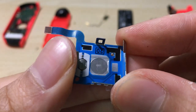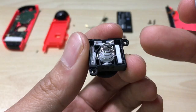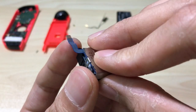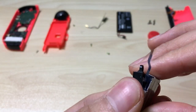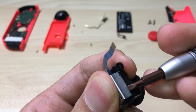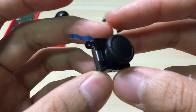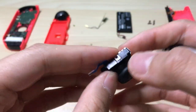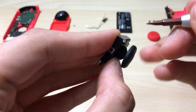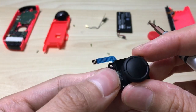Congratulations, you've made it this far. To reassemble, put the spring back in like that. There's a button here and you want to align it with the button on the Joy-Con. Put this on top and use the flat head screwdriver to pry it a little bit, just to make it slightly elevated, and then press them together. Just press the things back together. Note: I broke one clip, so be careful while prying it.